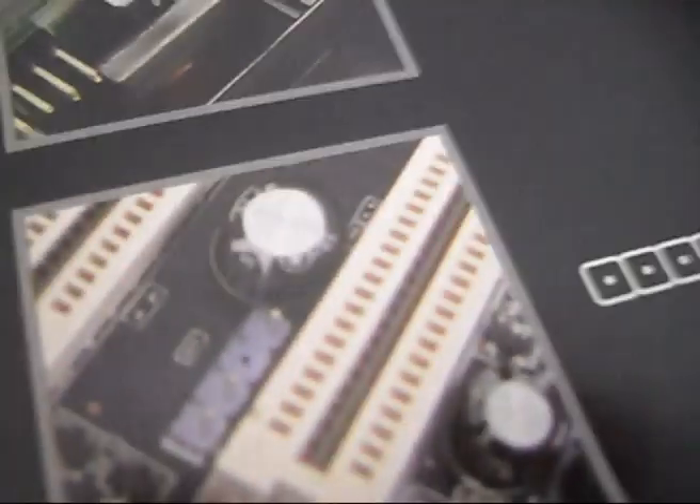There's also an HDMI adapter installation guide. Step one covers the SPDIF connection — you connect one end of the provided cable to the graphics card, then find the SPDIF header on the motherboard and connect the two ends to it. Connect pin 1 and pin 4 of the SPDIF header, then use the DVI to HDMI converter and an HDMI cable to connect to your TV.